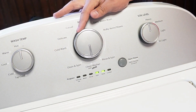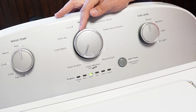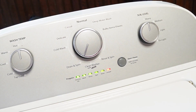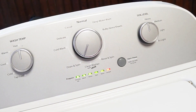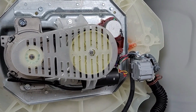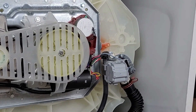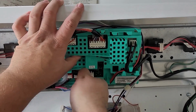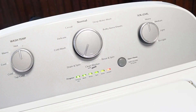Once you're in this mode, turn the knob clockwise four times. The rinse light should be the only one illuminated solidly by itself — this is the recalibration mode. Once you press the start button on the rinse mode, the door lid will lock and it will begin a series of tests and operations on your washing machine. All these tests take approximately three minutes to run all the way through. As the recalibration mode runs, every part and process on this washing machine is going to be run, and the machine will physically reset all the components to a default state, allowing them to run at an optimal level. This is a must-have when parts aren't working right or the machine doesn't know what state it's actually in, like after you've replaced the shift actuator or even a control board. During this time, you're going to hear all kinds of noises from the machine, and that's totally normal.